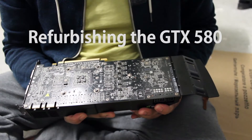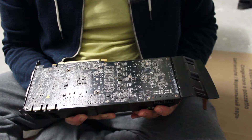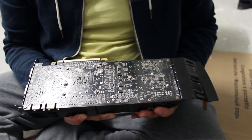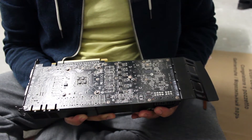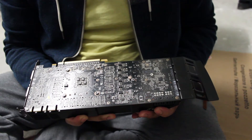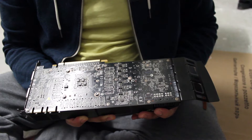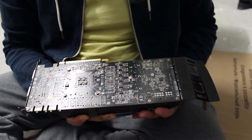So this is a GTX 580 that I've picked up second hand, which I've got completely scammed on. So this doesn't work. I will get a display output. However, installing the NVIDIA drivers, the driver will not communicate with this basically and I'll get artifacting on the display. In particular, what I keep getting is blue dots all over the display and occasionally the system will just blue screen.